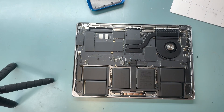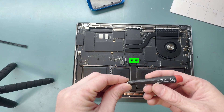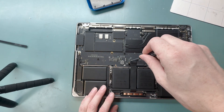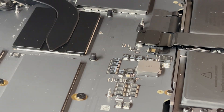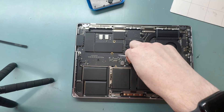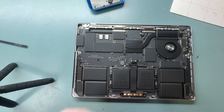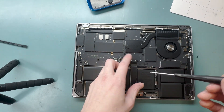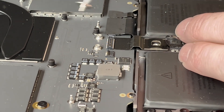It's not fully disconnected yet. Grab your T3 screwdriver and unscrew the trackpad connection to get to the battery connection. Then disconnect the trackpad connection and pull the battery flex cable up a little bit so you can get to the T5 screw and unscrew that to fully disconnect the battery.